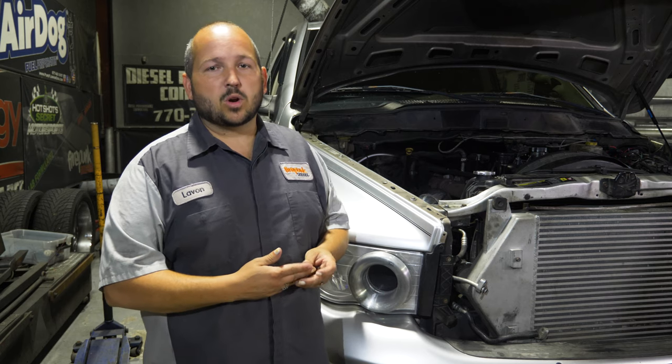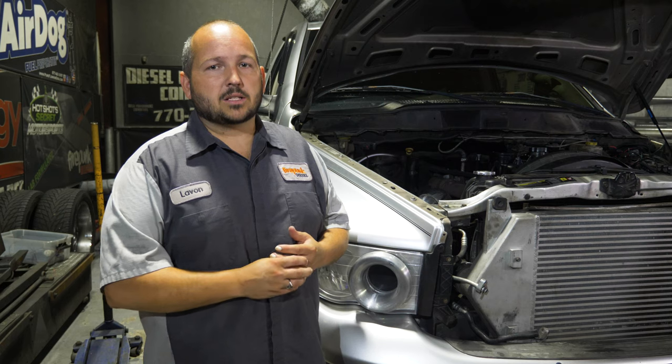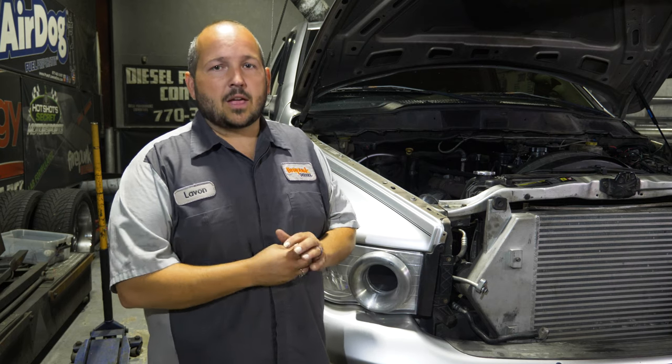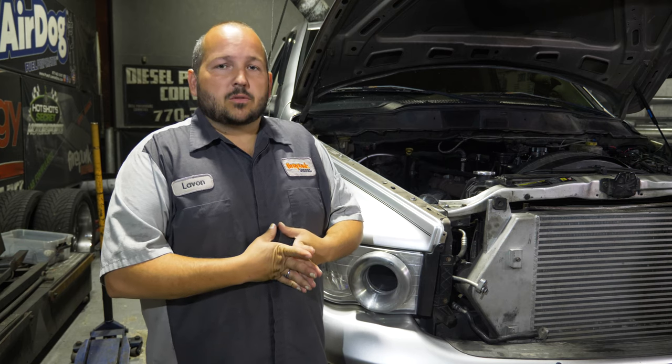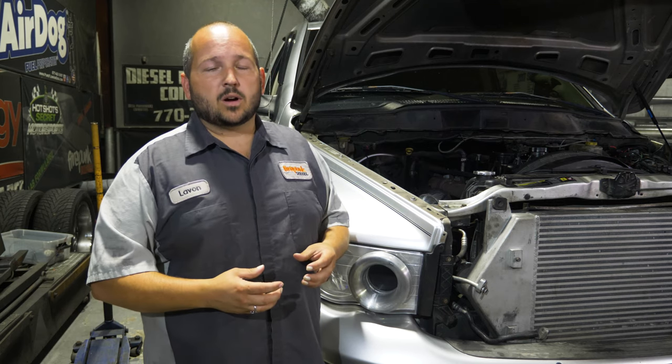We had on the dyno this morning the new turbo. It did 1,001. We had backed off the wastegate setting just a little bit because the thrust had been beat out of that original turbo. So Austin Tate didn't want to drive this turbo quite as hard, so we backed the gate off a little bit. It still made 1,001.